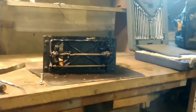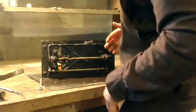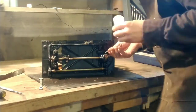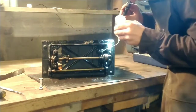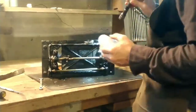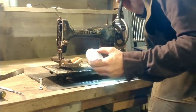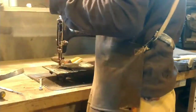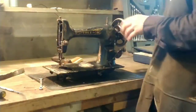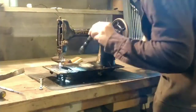I really can't figure out what's going on there. You can see how good it looks inside - that bronze slide is fine. It might be hanging up a little bit; a little burr is all it would take if it was run without oil. The raceway and bronze block in there - all it's doing is transmitting the circular motion of the balance wheel pulley into vertical motion. It's just a pitman arm, doesn't have to be accurate or on time, so I decided to just oil it up and run it and see if I can't get through those burrs.